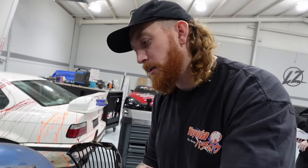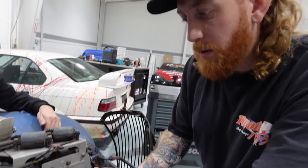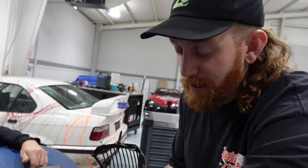And then, I don't know what's up here on these carburetors. Usually they're diaphragms, like to pulse, but I don't think that's what's here. So we'll pull the bottoms off and see how dirty they are. That's where all the fuel sits. Fuel's crappy, so it'll get junky in there. So we'll pop these off. We'll take a look and see what's going on.